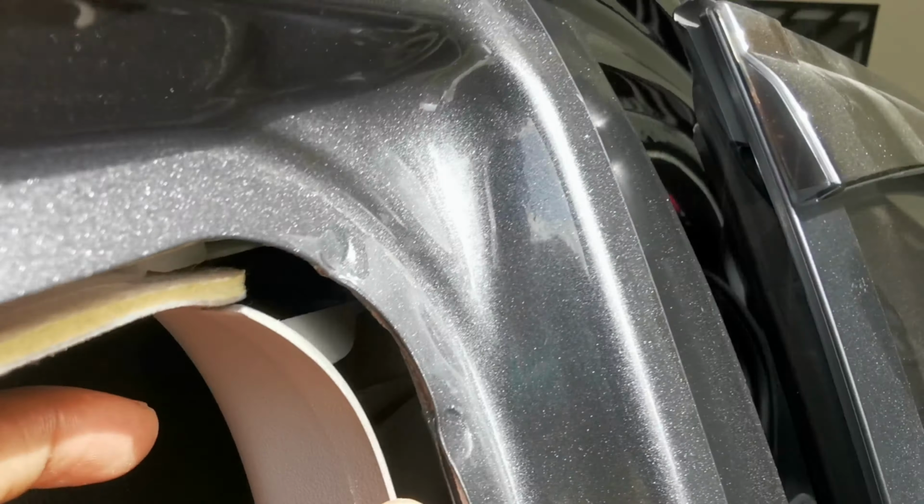This is the cable. We have to draw the rest of the cable back here, inside the trunk. The remaining cable should be all out here. Now we are going to proceed by making a hole on this part, but we have to remove all these locks to easily have access behind, where we are going to pass the cable for the rear view camera.